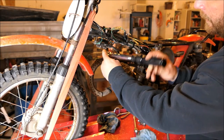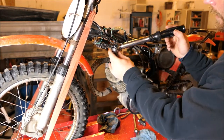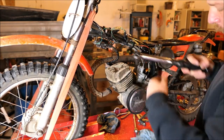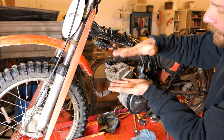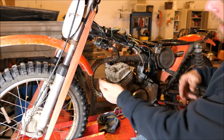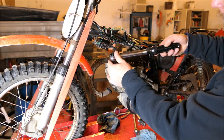The main reason we torque stuff — of course it's so you don't strip bolts — but also the reason you torque something is so that it has a nice even seal on the gasket. If this bolt in this corner was looser than the rest, the gasket would fail there quicker than any other spot. That's why you torque stuff down.